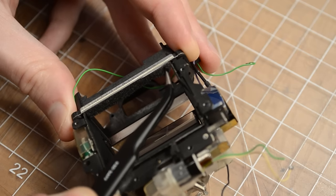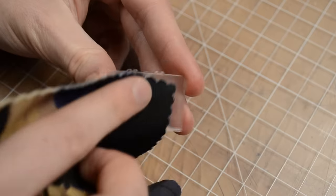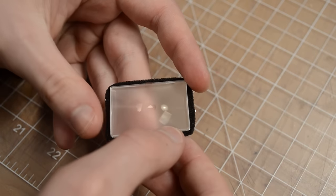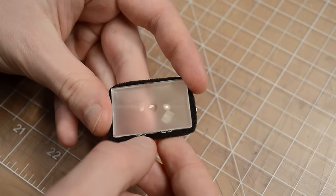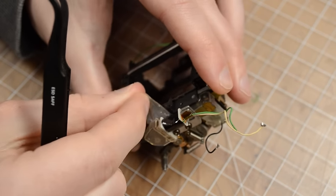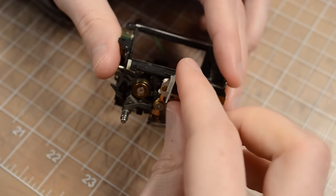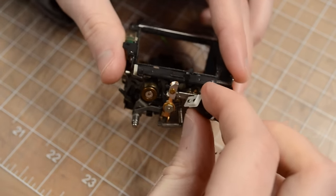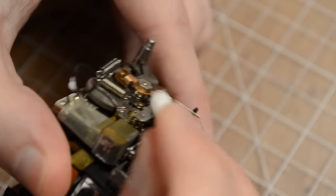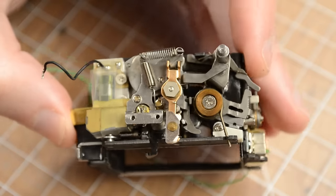I'm not sure exactly what type of plastic was used to make these focusing screens, but the problem is you can basically breathe on it and it'll get damaged because any amount of friction is going to scratch it right up, and then it's just going to haunt you every time you go to take a photo. Here's a nice little bit of engineering from the team at Minolta: this piece of factory scotch tape keeps the mirror magnet nice and clean from any sand, dirt, and debris that gets within the mirror box. We're going to wipe that down with some isopropyl alcohol to make sure everything's cleaned up. From here, I'm just going to finish cleaning and lubing the rest of the mirror mechanisms.